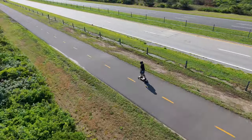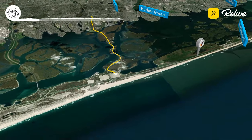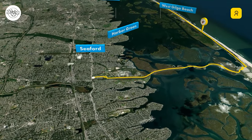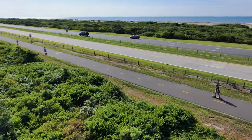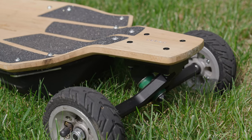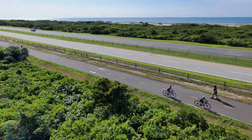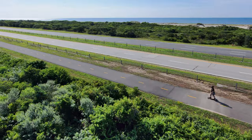As far as range goes, I did a bit of a range test, although not a complete one. The battery outlasts my desire to keep riding, which ends at about 20 to 25 miles straight — less if I'm having to deal with a problematic drone. The numbers I was looking at during rides pegs this battery at about 50 to 55 miles of range, at my 190 pound rider weight, traveling at about 20 to 22 miles per hour in 85 degree Fahrenheit weather. The range is also given a boost by the 5 inch pneumatic wheels. These are custom tires on a custom rim, and their size and build tend to consume less energy. Generally, my riding on any given pneumatic wheel e-skate consumes about 30 to 38 watt hours per mile. On the Tabor, I'm consuming about 25 watt hours per mile, so it ends up giving more range than another board would with the same battery.